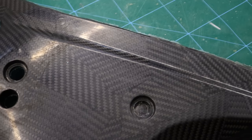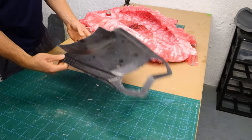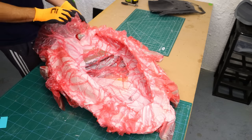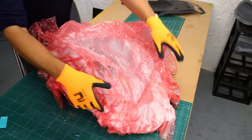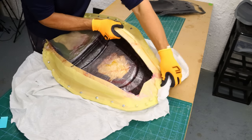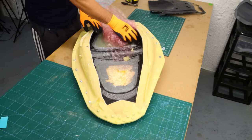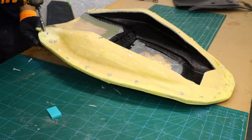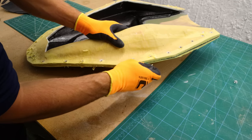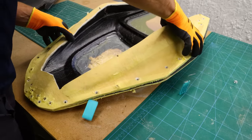The edges and corners are nice and sharp. Now let's see the part I was most excited about - in these moments I always feel like a kid at Christmas. Unfortunately the bag won't be reusable: as soon as one heat cycle hits the bag, the plastic hardens up and gets kind of fragile. If the breather cloth won't get soaked in resin, you should reuse it.